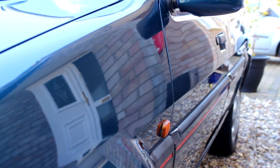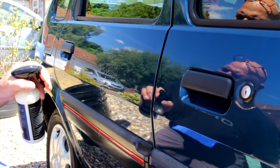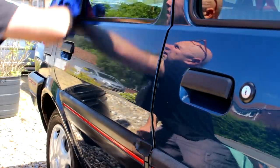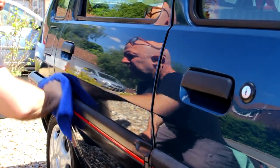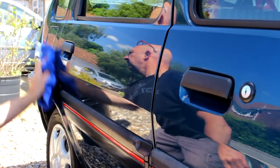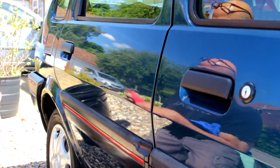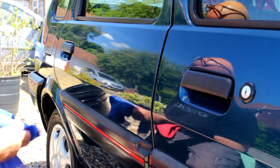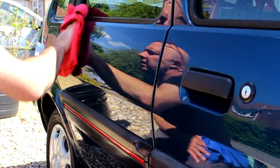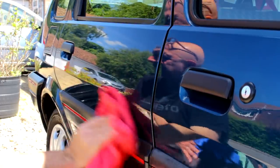So this is the hybrid detailer. Two to three spritz on the panel. Use your noggin — if it's blowing a hoolie, if it's very windy, apply it to the cloth and then onto the panel. You're going to want two cloths: one to apply, one to remove. Go for a short pile microfibre if you can. It's slick and leaves a really nice finish. You will see by the water behaviour in a bit that it does the trick. They reckon six to eight weeks of protection — you can use these as top-ups or as standalone products; you don't want to apply wax or a sealant over them.